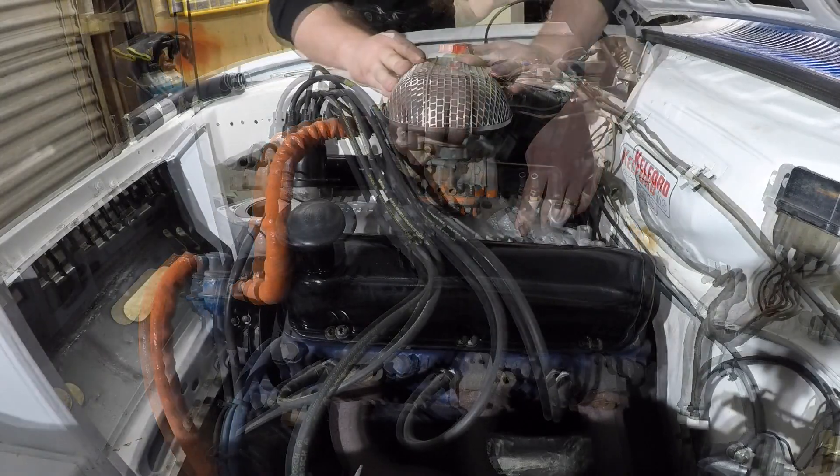So there we have it — I have ported out the D-port intake manifold that suits the cylinder heads on my car and got those lining up much better than the original mismatched oval intake I was running. I'm pretty confident it might actually see some noticeable gains on the track. We might be talking a few percent horsepower gain, but I sort of think the cross-sectional area we've increased those ports by is probably in the range of 30 percent. I'm not expecting 30 percent more horsepower, but we might see 10 percent and could notice that, so it'll be interesting to see what happens when we take this car back out on track. Thanks for watching — hope you learned something, I certainly did, having not mucked around with the two different types before.